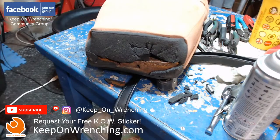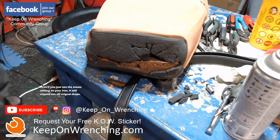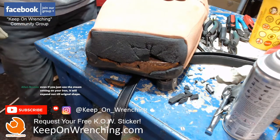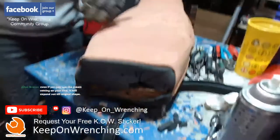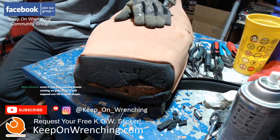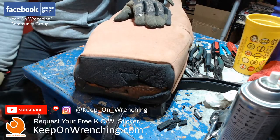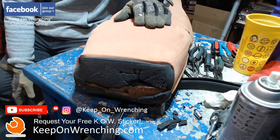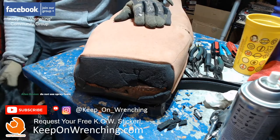Alan, are you going to steam the foam before recovering? Elaborate on what you're talking about. This is the first seat that we have ever really tackled. I don't think we even knew to steam it. Even if you just use the steam setting on your iron, it'll expand it out to original shape. Awesome. I have an iron. We could actually try that. I had no idea that was even a thing.